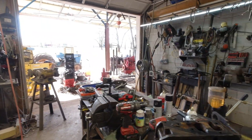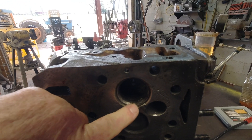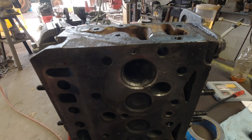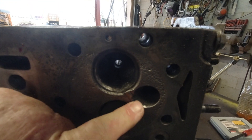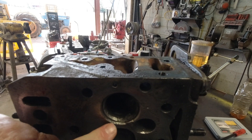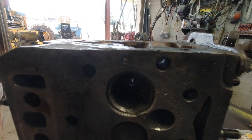Got the head pulled. I'm going to take the camera and see if I can show you a few things. As you see, right here, you can actually see a little piece of slag right there. And the valve seat doesn't look completely round. Right here, it appears the head has got a weld on it. This valve here did not hold — was not closing all the way for sure.